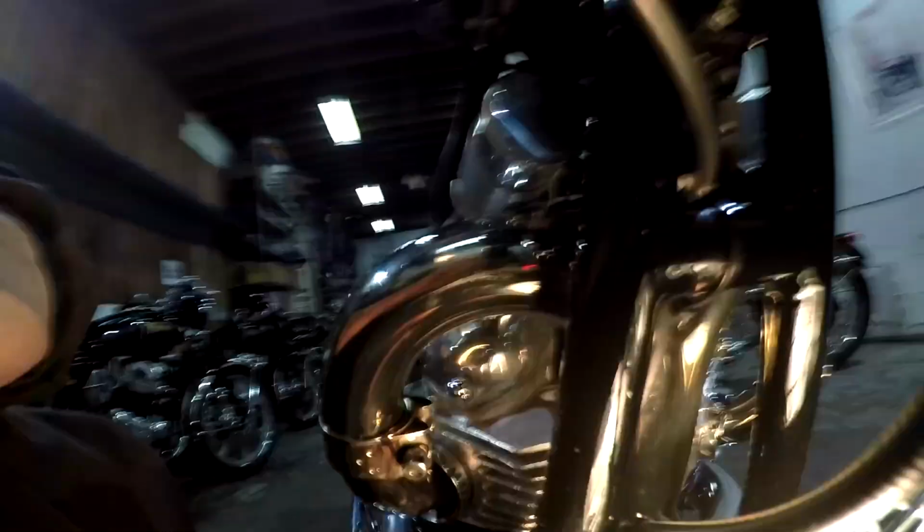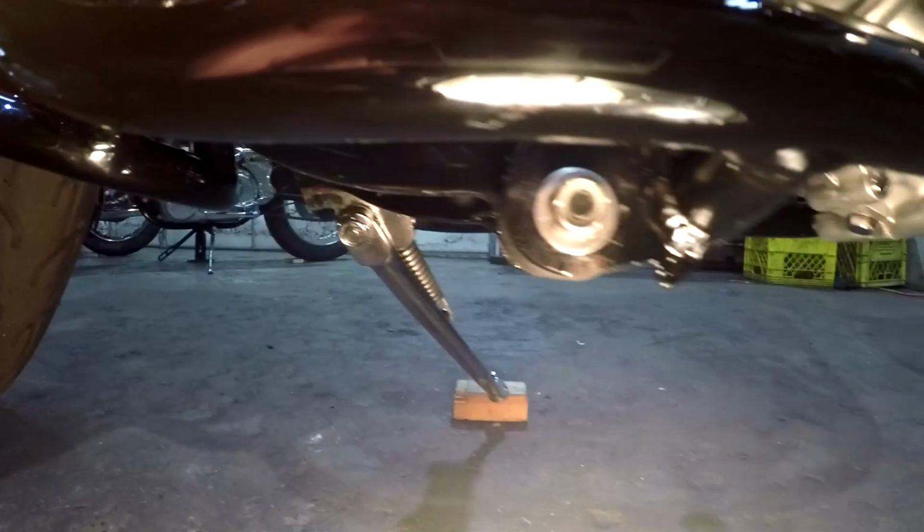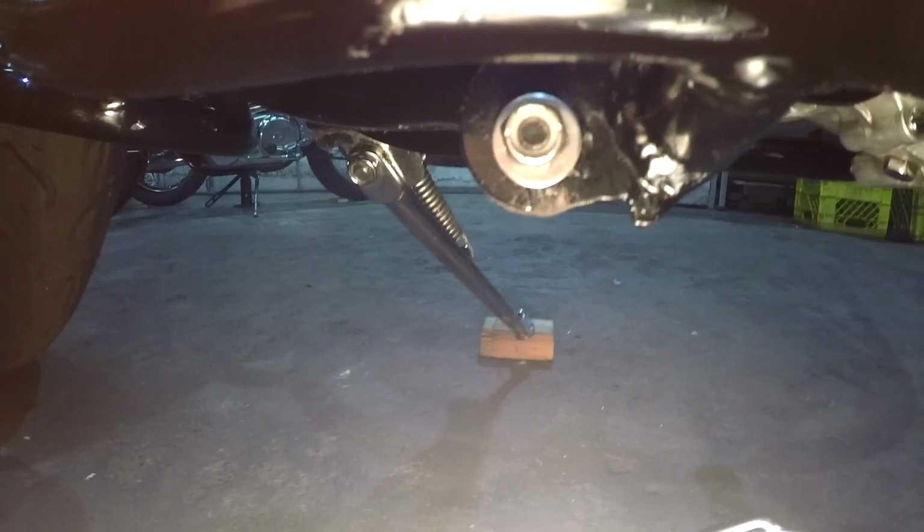So, that's a very strong neck. The neck is extended from here, and the neck actually starts here. And then down here we have a cross member, also overkill. And down here is another cross member with the side-to-side extra motor mount, same as on the top. Side-to-side exhaust grommet, same as the top motor mount. If your Norton doesn't have your top motor mount and these in mint shape, your Norton will handle like an elastic band. Doubling up on these makes it more secure, does not add any vibration compromising at all.